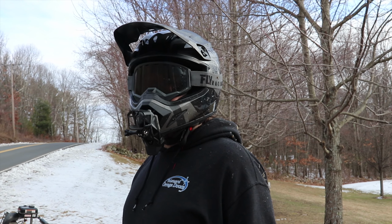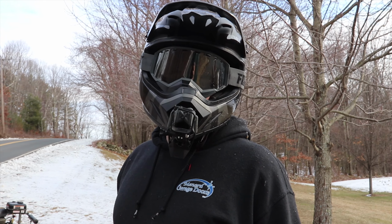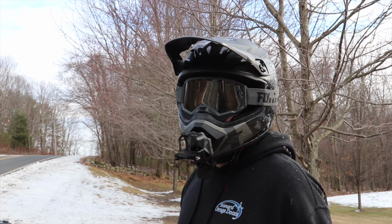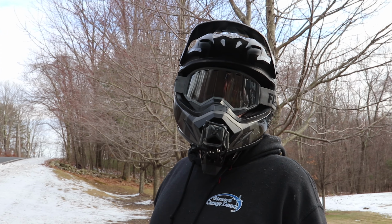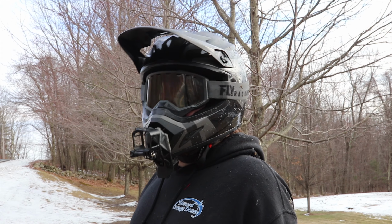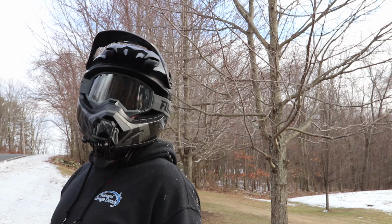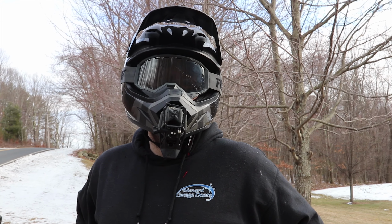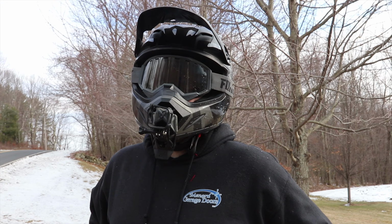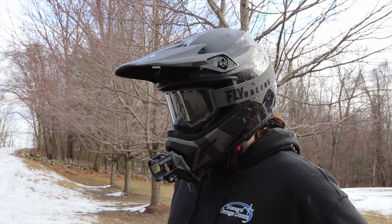I think we just need a little more miles per hour. They do have a 15 tooth sprocket for this. Maybe we could get away with just going to the 15 tooth countershaft sprocket. Probably. If we can get 8 miles an hour out of every tooth, you go from 37 to 40-something, 45. Be happy getting close to 50. I think that'd probably be the ideal top speed for this thing. It's a little shaky. I don't know how fast I want to go in it.